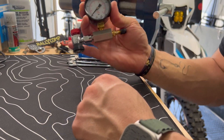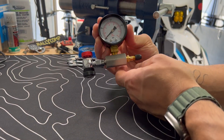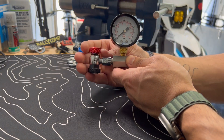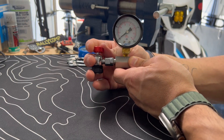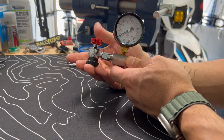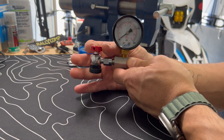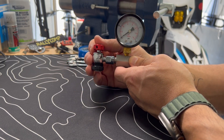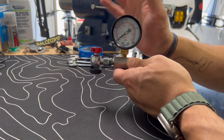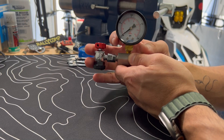Let's talk about this thing. Super simple - this is a no-loss air chuck with pressure gauge designed for filling up motorcycle suspension, vehicle suspension, or if you have a tubeless system on your motorcycle. Very simple to use: the Schrader valve goes in on one end, once it's completely screwed in and sealed you twist to get the pressure reading, fill it up, then undo it. It's a quick and simple DIY tool you can make for your garage.